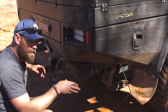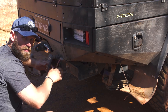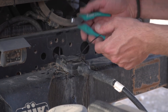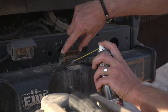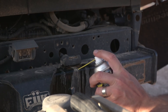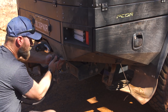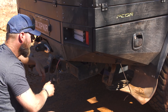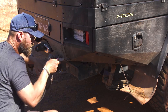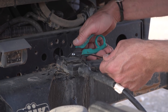I've seen people in the four-wheel drive industry recommending you cable-tie crossways on your plugs — I think that is a bad move. These connections get a lot of dirt in them, so I would leave them loose so it's easier to check. More importantly, if something gets caught up you want the plug to pull off rather than have the wires snap. If you put cable ties around and secure the connection and it gets caught up, it's going to snap the wires and they may contact each other. Don't use cable ties, in my opinion.